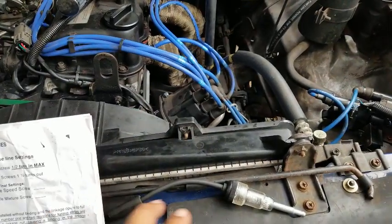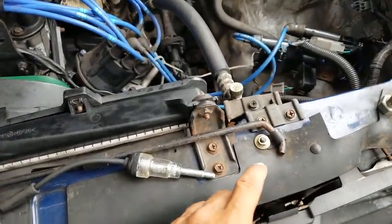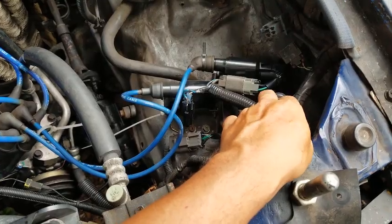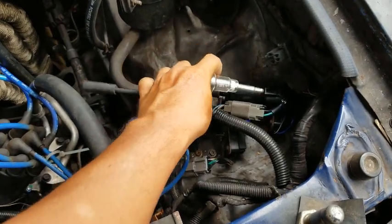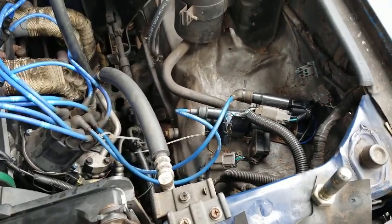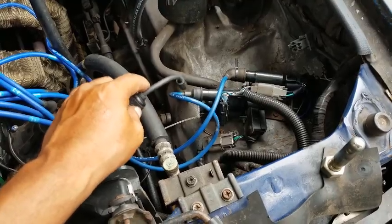But anyway, I also wanted to show you guys physically how this works, like actually show it to you in action. So I do have footage, because I already replaced all these items and fixed everything. This is how I learned that the ignition control module on the intake side was bad, by hooking one end to the ignition coil, and then this end right here to this spark wire, or ignition wire, whatever you want to call it, and there was literally no spark at all. And just to verify what I was seeing, I hooked it up to this one, and this one was sparking really good.